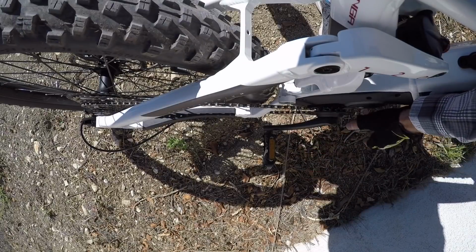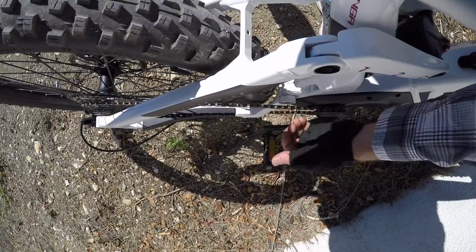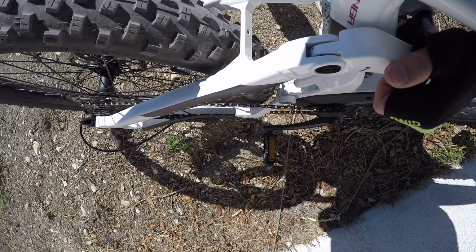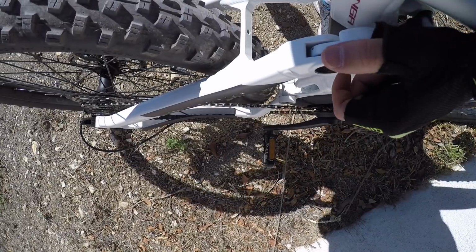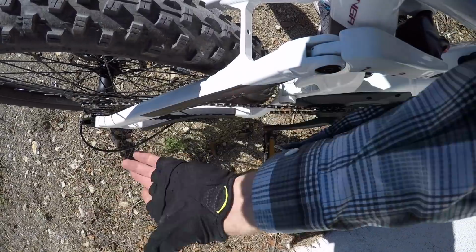I haven't experienced that so much, but I want to be completely fair here. There is some movement on the rear suspension, but it's multi-link here, so it travels up and down fairly consistently, and it brakes fairly well as well. It's the kind of shock that you've got 3 different positions, so you can do climb, trail, descend. I definitely recommend adjusting that depending on where you're at on the trail. 11 to 42 teeth in the rear with those 10 sprockets.